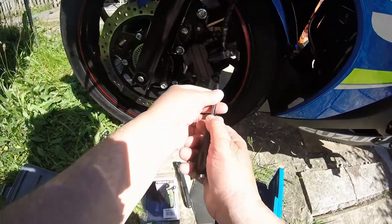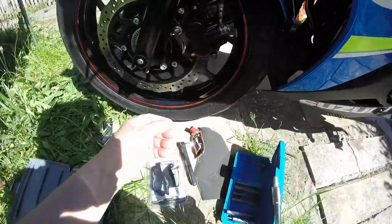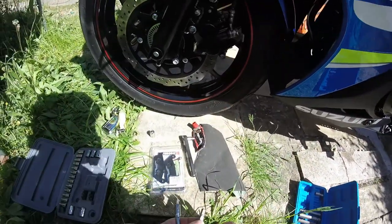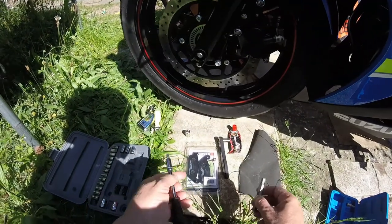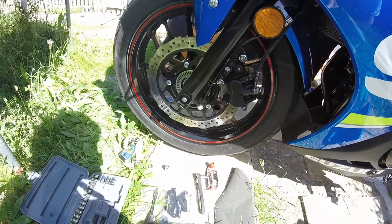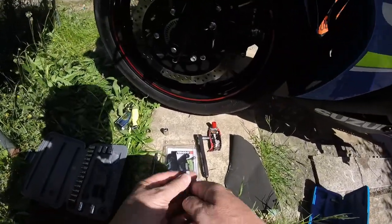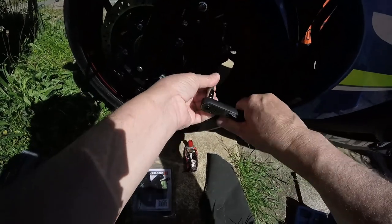So you just want those two sockets. First you've got to take this cover off here, which is for the pin — so that's a cover. Save everything on this side so I know where everything is. Then you've got the pin inside. I just need to use one of these as well. We've got some grease to put on the pin when we've taken it out. Using 10mm just to crack this one off first — just crack it off so you can get it out.